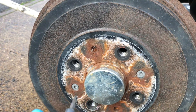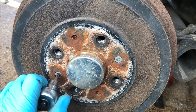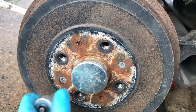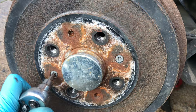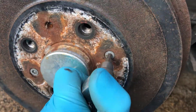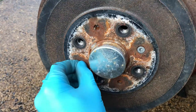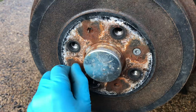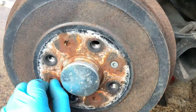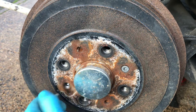These fasteners are just T30s — literally just remove these two. I've got the handbrake on to stop the drum from spinning. I might need two hands for this. Remove these two screws and the other two on the other side, and once I've done these I'll be back in a second.